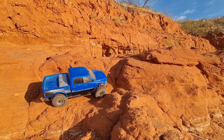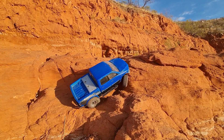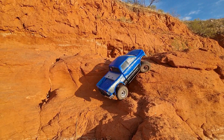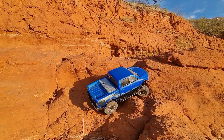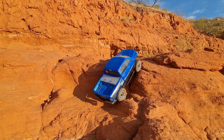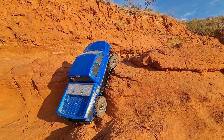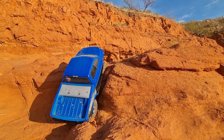Hi-Rax and Hobbywing — great combination. And this truck's a little loud also. It's got a 3D printed gear for the spur gear. I've tried to quieten it down, but if you make it really tight, it kind of quiets it down. But if you make it the tightness it's supposed to be for your spur and pinion, it's just loud. But I like having a bigger spur gear to give it a little more torque.